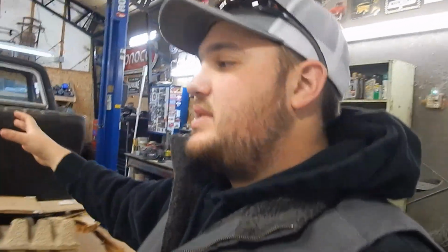Just wanted to let you guys know what's going on, what the plans are for the next few weeks. I've only got about another week and a half here at home, maybe a little less, to get some of this stuff done. There is some final welding that still needs to be done on the back side. Just a little bit of tedious finish up work, and then that whole side needs seam sealed. And then we will move on, probably check out my rocker on that side over there, and then we'll see where that gets us. Hopefully I don't have to replace that many more metal parts, but the cab corner and the inner cab corner are going to need it definitely, but we might be leaving the rocker alone completely, which will be cool. So I'll definitely keep you guys along with that.